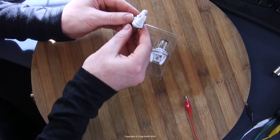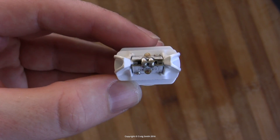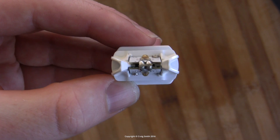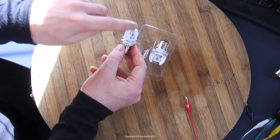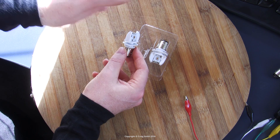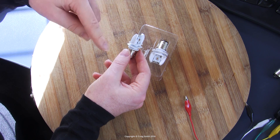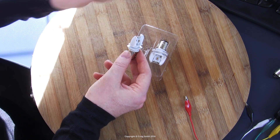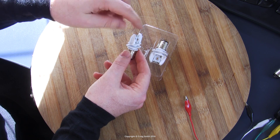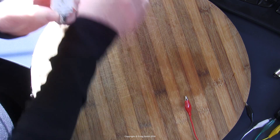The chips are mounted one on each side in a wedge orientation, so the light is clearly intended to project out to the sides. At the point where the two hemispheres of light intersect, there should hopefully be some overlap, so you don't get any lack of light around that area despite the chips being oriented opposite each other.